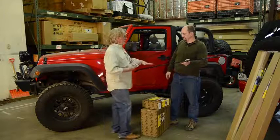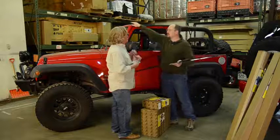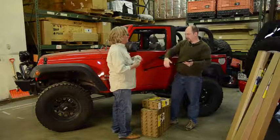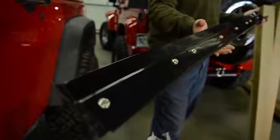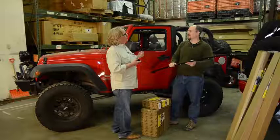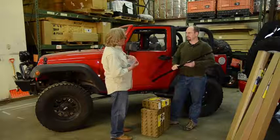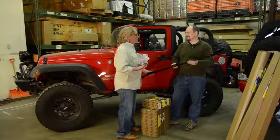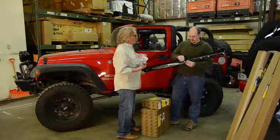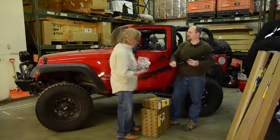This is the standard JK header — the header you use for anything that does not require a cable. So if I have any Jeep that does not have the cable top, this would be the one I want to get. It's something that's going to either clip into the door surround like the early-model JKs, or one of our designs intended to be attached straight to the roll bar. The fabric from the bikini attaches to this. It mounts directly to the top of the windshield where it's clamped down using a bracket and a knob. This one requires a little bit of assembly on the windshield header first — there are a couple of brackets you'll have to put on. Once you've got that assembled, you just snap the fabric onto it, put the fabric around the edge, snap it in place, and clamp it down.